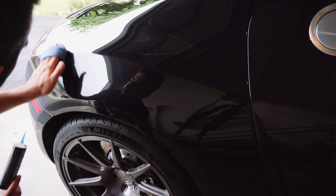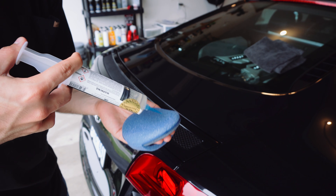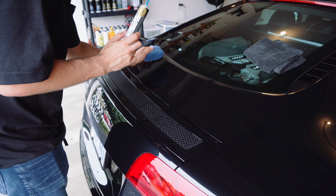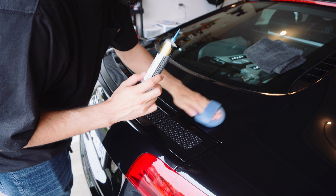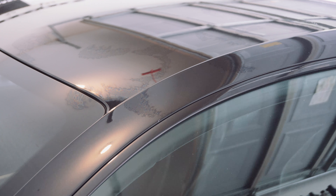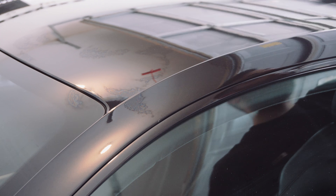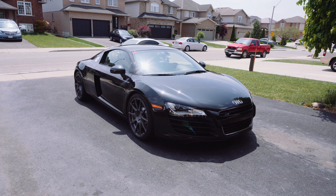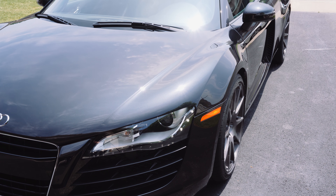Just know that as long as you can see it going on fine, you'll know when it's running out of product — so don't overuse it. Arguably the most important piece of advice: do not do more than one section at a time. If you apply a section and let it flash for too long without wiping down the high spots, that extra ceramic coating is going to be stuck there and you won't be able to buff it off. The only way to remove it would be to use an orbital or dual action polisher and actually polish that section off. So work one section at a time and stay on top of it.